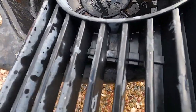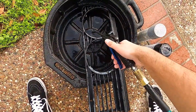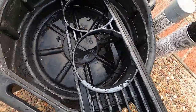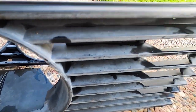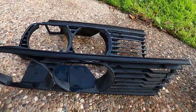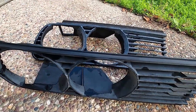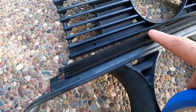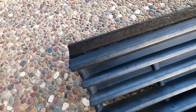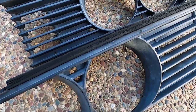If you have some dirt, leaves, or other little stuff in between everything, and if you have a compressor you can use one of these air nozzles to blow it all out. If you don't, use a brush or anything to get inside. If there's still dirt left you can just get a rag and swipe across to make sure there's nothing there. Let it dry after you're done. With your tape, cover the top chrome part — you just want to paint the plastic, not the chrome trim.